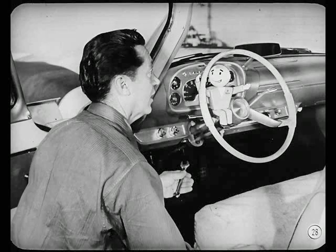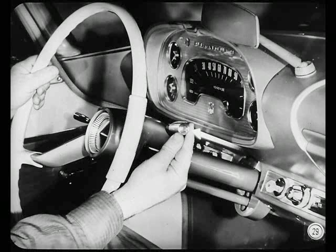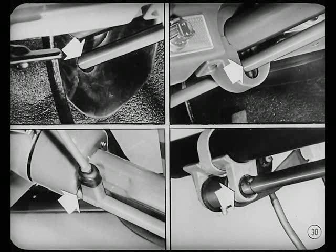With proper clutch adjustment and a fully releasing clutch, the next thing to check if you still had trouble shifting is gearshift linkage. Check for binding in neutral by raising the lever several times and releasing it — the lever should return to its normal, fully released position. If the lever binds and won't return, look for gearshift rod binding at the floor pan and at the column jacket bracket at the instrument panel and at the upper and lower rod supports.